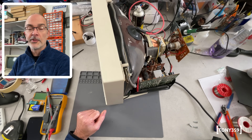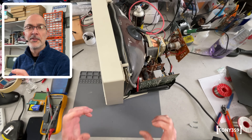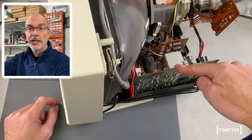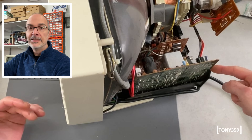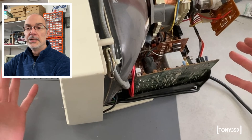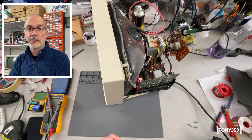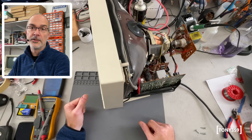Last time, as I said, it was the flyback transformer. I could hear a whiny noise coming from the monitor, and that's usually a shorted flyback transformer. I didn't show that on camera last time, but this is the power supply board — the main power supply. We've got 220V coming in and a number of DC voltages coming out. Last time I could see those voltages were not reaching nominal values, as if something was shorted after the transformer, so the transformer was protecting itself. I haven't done many checks this time, so let's do this together.